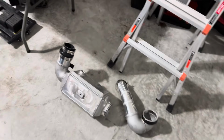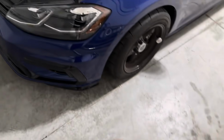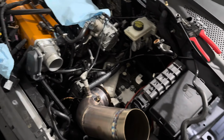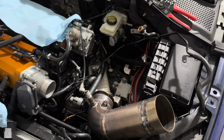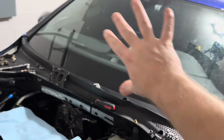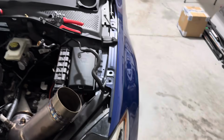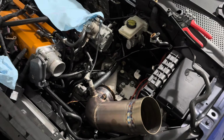More people want to ask about the air-to-water, or I'm sorry, the water to ice and then the coolant to dry ice. That's something that ChatGPT actually came up with. It originally had said to run methanol or some type of alcohol, and then run the dry ice along with it. But obviously methanol and alcohol are flammable, and I don't really want to deal with that inside the car, as well as just the smell in the car on methanol or alcohol would be atrocious. The smell in general on coolant might not be the best, but it's more bearable than methanol or alcohol, in my opinion.